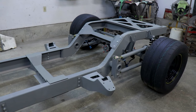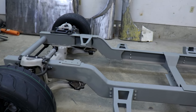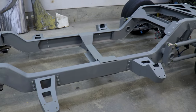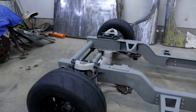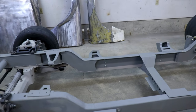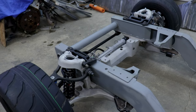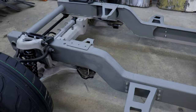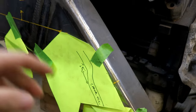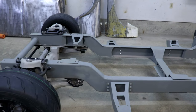With those two measurements I started working on the frame rails. I kind of based my design off an original C10 chassis where the middle of the chassis drops down for the cab, but I actually dropped it quite a bit more than an original chassis to allow the cab to sit lower — that way I could have the entire truck sitting lower without having to C-notch the rear or use smaller coilovers in the front. I just used the frame itself to lower the truck to where I wanted it to sit. From there it was pretty much a trial and error process. Once I had my front crossmember installed, I noticed the front of the frame was too tall, so I had to cut it at the joint and drop it down a bit.